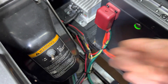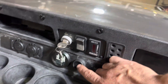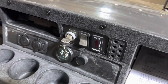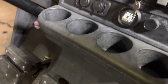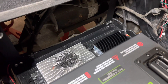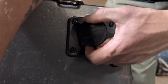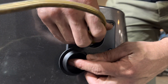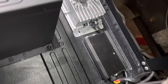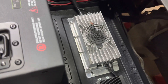Put your cart in run, go ahead and put the key switch in the on position, and test the lights to make sure they work — which they do. Put it in forward and lightly hit the gas. We have cart operation. At this point go ahead and max-charge your battery — plug your heavy-duty extension cord into the charge receptacle. You'll know the charger is on because the fan on top is running. We'll let this battery max-charge and then take it out for a test drive.